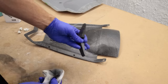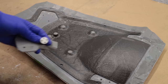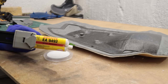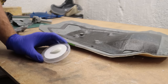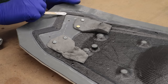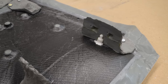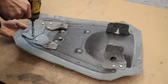I made a small bracket out of carbon fiber to hold the lights in place, using the original part to make a mold for that. The rest of the pins and mounts are 3D printed - this way I can save some costs and time when I make these parts again. I used Loctite EA9492 high temperature adhesive. In the future I would like to run the exhaust under the tail, so I want to have a heat resistant bond underneath. After curing the part at room temperature, I had to post-cure the part to make sure the adhesive would work as it should.